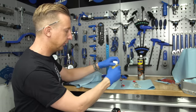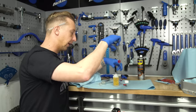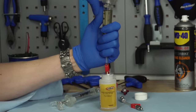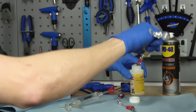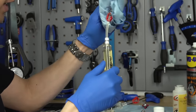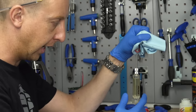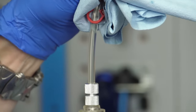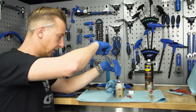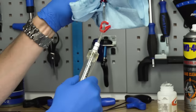When you fill these up, take care to make sure there are no air bubbles inside them. After you extract the oil from the container, carefully get the syringe upright and put a rag over the end — you don't want this to go anywhere, especially not near your eyes. Just push the plunger through so you're getting rid of any air in there; you can see it rising up through the tube. Do the same process with the one with the bleeding edge adapter on. On that one you only need the tiniest amount of fluid. Now the syringes are ready for use.